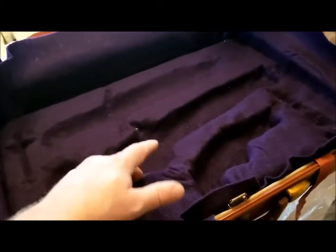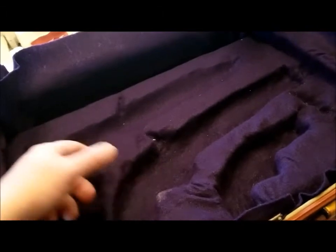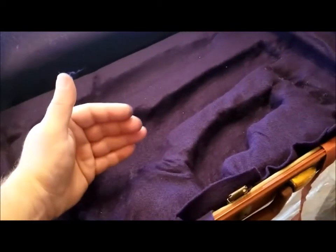Then I took this area and rolled this back the same way, gently rolling it back, so I keep it where it is right now. When I put it back down, it'll be in the same spot. So just take your time, roll it back, keep it where it needs to be. Again, another coat of the spray adhesive, and then I started working my way from here out, then there out, and then there out, trying to stretch it, making additional cuts to give slack as I needed so I could straighten it and pull it so I could get this pretty tight.